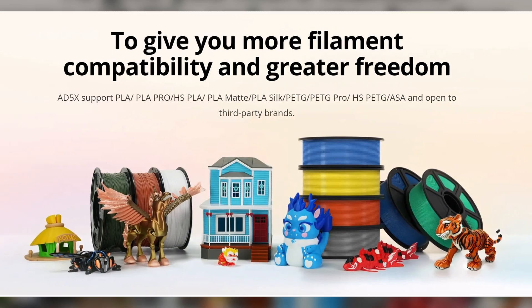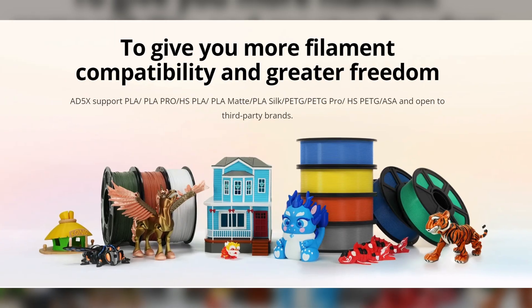It does support multiple filament types: PLA, PETG, PLA-CF, PETG-CF — I think CF is for carbon fiber — and TPU-95A. It does do auto leveling, which is excellent. What that does is make sure the computer processor knows what's going on with the print surface. If the print surface is two millimeters off, it'll come down and check in all sorts of different spots so your print will always stick well. If your bed leveling is off you can have all sorts of mess, so it's really nice that it has built-in auto leveling.